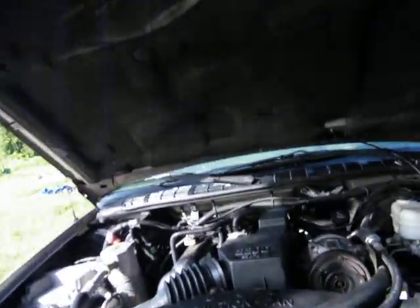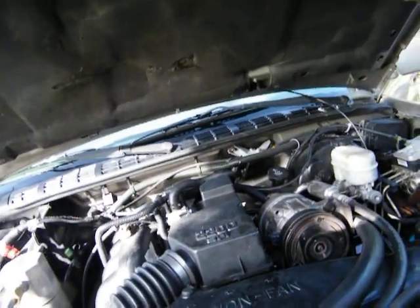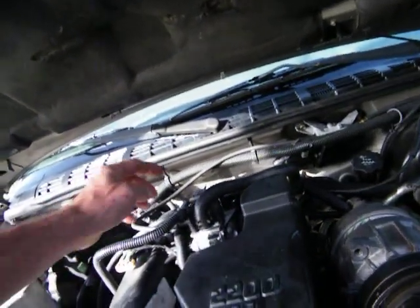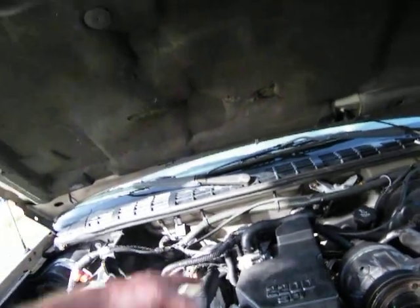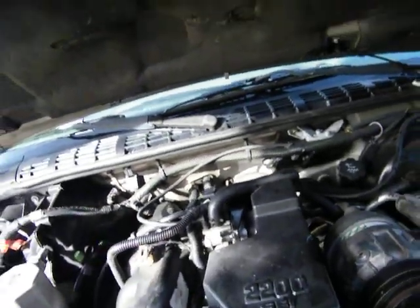So that's the project. And then bleed out the fuel rail some more — I haven't done that yet. But once you just crank right up, it rattles a little bit. But that could be because I need to get another intake air mixture thing, and while I'm at it, I'll probably go ahead and get a throttle positioner for it, you know.